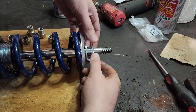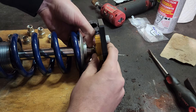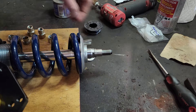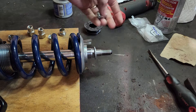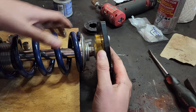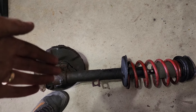There are two washers they say to use, but if you mount the camber plate straight onto here those washers are going to contact the aluminum — I'm guessing that's not the right way. There are a bunch of different spacer insert things. I'm guessing this one goes in here first because it can slide over this part; all the other ones can only slide over the threads. So we use the part that slides over here, but before that they include one smaller washer — put that on first, then slide on the small sleeve. It rests on the washer and that washer protrudes just enough that the larger washers will ride on that and not on the aluminum. Alright, this side is all done and buttoned up — I'm going to quickly knock out the other side off camera, and once that's done we can reassemble the front of the car.